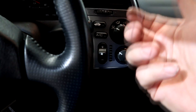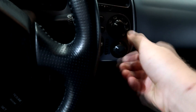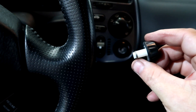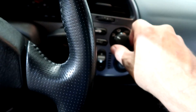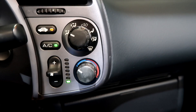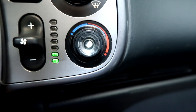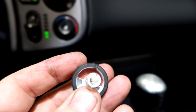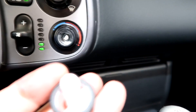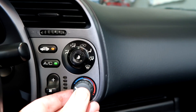These are really easy — don't go crazy, don't put a screwdriver behind it, don't grab them with pliers. Just hold them firmly and they should come right out. These knobs are kind of sticky, but just pull them straight forward — don't bend them. They've got a clip on there, so don't pull them to the side in case you damage them. There's a D-shape on there, same as on the shaft it pushes onto — don't force it on crooked and break it. Line that flat up with the shaft, twist until you feel it line up, and it just slides on.